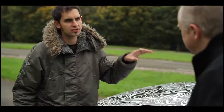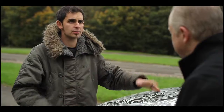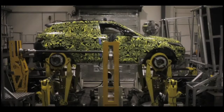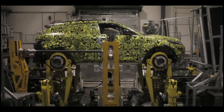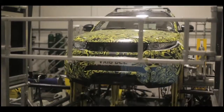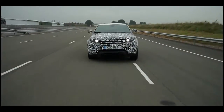Let's talk more about the adaptive suspension system of the Evoque, because after all, that's critical to all of those road manners we've just mentioned. It uses a system called MagneRide, which uses a magneto-rheological fluid. It's basically oil with very, very small iron filings. Instead of having any moving parts, it uses an electromagnet that changes the viscosity of the fluid. It monitors steering wheel, throttle, brakes, damper travels and vehicle speed about 1,000 times a second. It predicts what you're going to do to the car next, even when you've been at your most unpredictable.